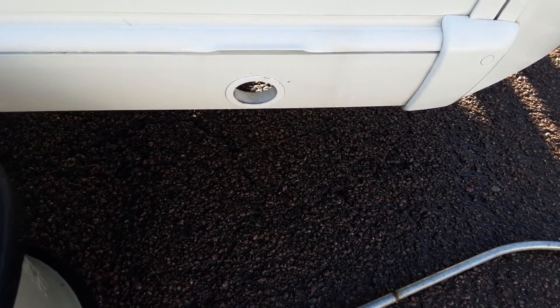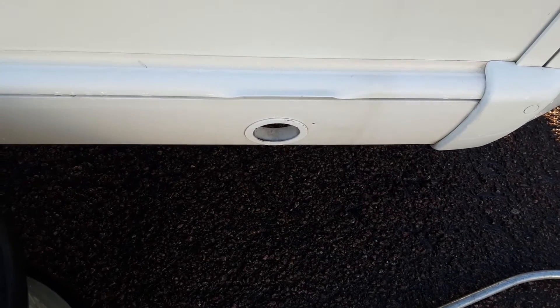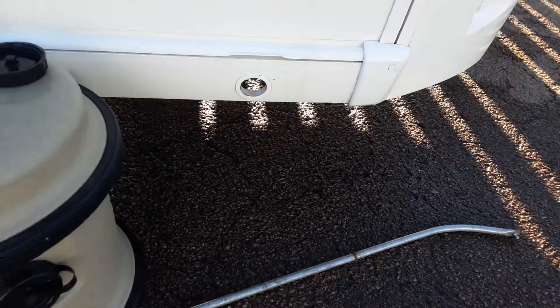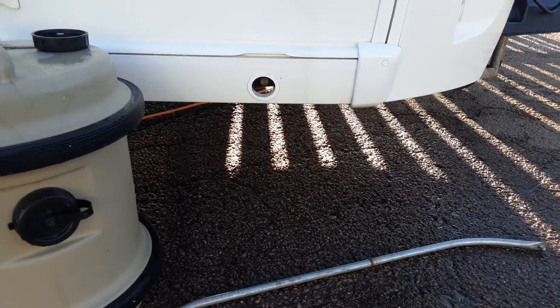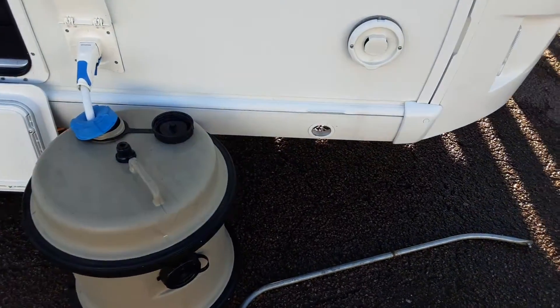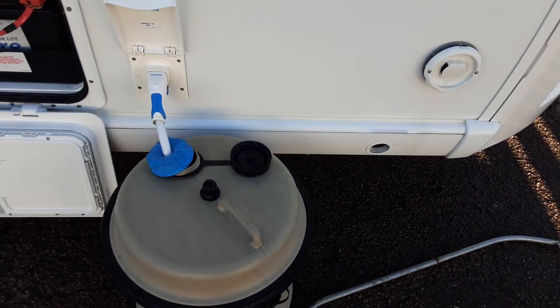You can never lift the caravan with these legs as you can potentially damage the floor. You put your bar in through that hole just there and you'll see the nut just through the hole — that is essentially where the leg winds. There's one of those on each side at the front of the van and two on the rear.